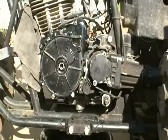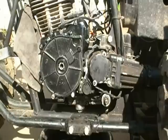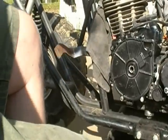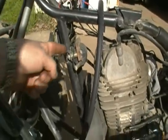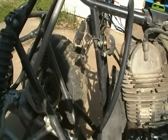I'm going to change out the coil — I got that new coil, I told you I didn't like this one. Then we're going to put the battery in it, turn it over, and see if we actually get spark. I'm going to grab that coil and take this one off. That coil tested out good, but the end wire on it is crap — that's why I'm doing that. It's simple: you just unplug this, unplug the ground, unscrew it, take the ground out, undo the two screws, put the new one in. I'm not even going to waste my time showing you that — you can figure it out.